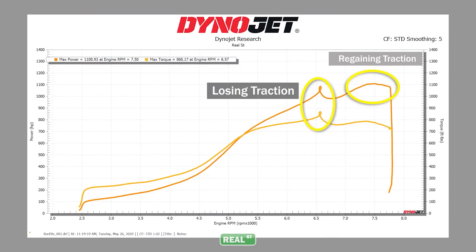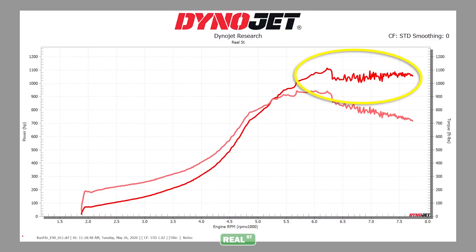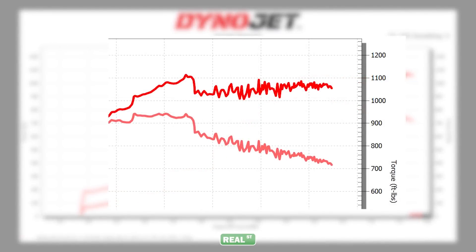Now let's go through some examples of problems you may run into at the dyno. The first is wheel spin. On an inertia dyno, you need to maintain traction during the run — as this turbocharger increased boost, the tires came loose on the dyno, then eventually caught back up and met basically where the old run was. That's just a traction problem. The next example is knock retard: the ECU saw what it deemed to be cylinder knock or detonation, pulled ignition timing, and added fuel — that's where you see the decrease in power that eventually starts to come back up as the engine regains control.